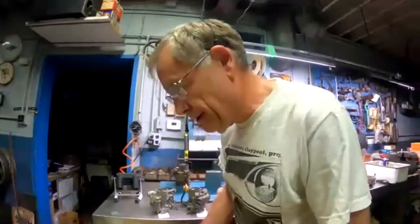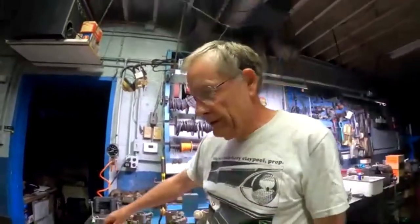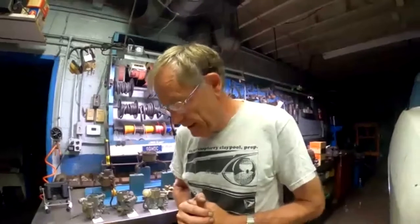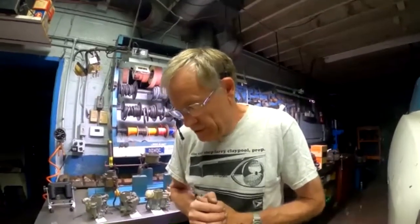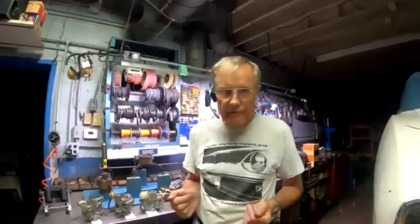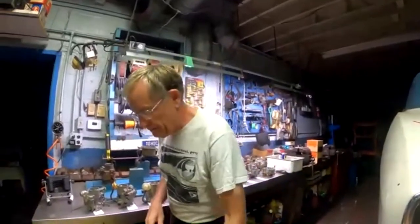And then on August 30th, they had another bulletin out and basically told people if they were restarting their Corvair and the engine didn't start within 10 seconds, to slowly push the gas pedal to the floor and hold it there, just like the engine was flooded. And they said, do not operate the starter more than 30 seconds continuously without a brief pause to allow the starter motor to cool off. So this was getting to be a problem. Cranking your car for half a minute, it's not starting. Like I say, it was starting to cause problems.